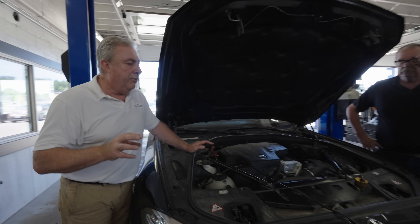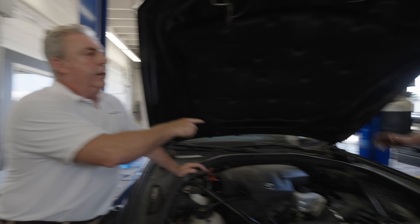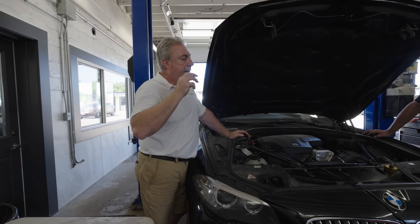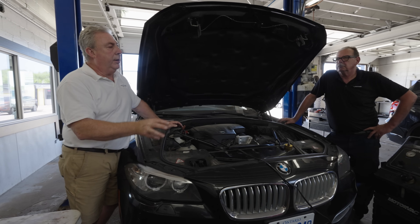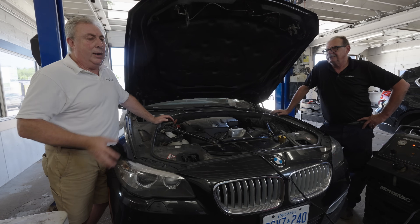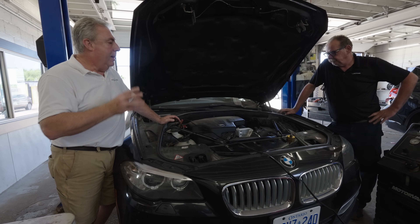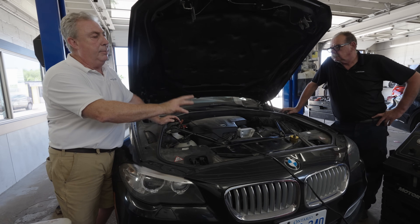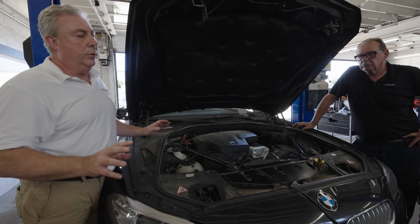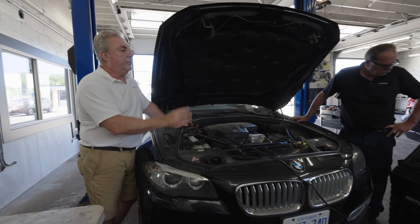You can do this at home if you're a DIY type. You try to get as much fluid out of the reservoir as you can, flow it in through the whole system, then you've got to sit in the car and pump the brakes to get all that fluid out through the bleeders. How long is that going to take? About an hour of pumping on brakes. So you can do it manually if you've got a big right leg, but this machine does it brilliantly — it's automated. This car owner is going to be driving for another three or four years without any brake problems.